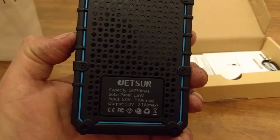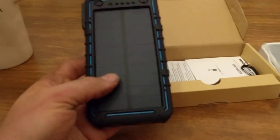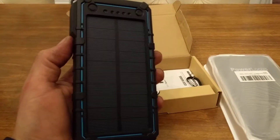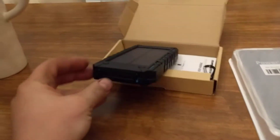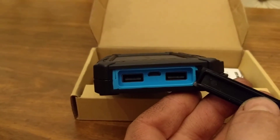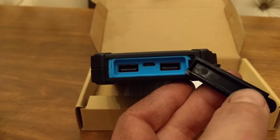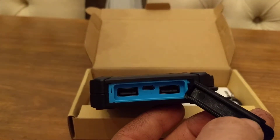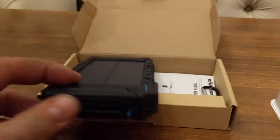The solar panel only does 1.8 watts of input, so as you can imagine that would take a very, very long time to charge — some people were saying up to 72 hours, so a few days of sun would be required to bring it to full charge. It's not meant to be used as a solar charger on a daily basis; you'd want to plug it in. We have two USB ports, and with them being blue you might assume USB 3.0, but I highly doubt it. A lot of these use antiquated technology — and the charging port is USB micro, which is pretty sad. You'd think by now they'd start doing USB Type-C for charging.